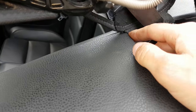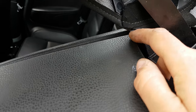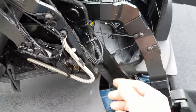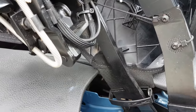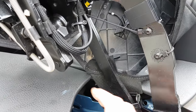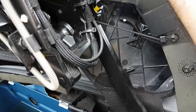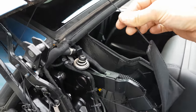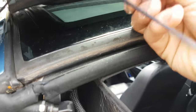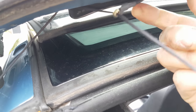So what causes that? After watching the roof go up and down a good few times I came to understand how all the cables, wires and springs act together. That led me to two bits of cord that I suspect are involved — the cord that interacts with the back goes up to the top and seems to be held by a little eye on a piece of elastic, and that piece of elastic seems to be fairly loose.